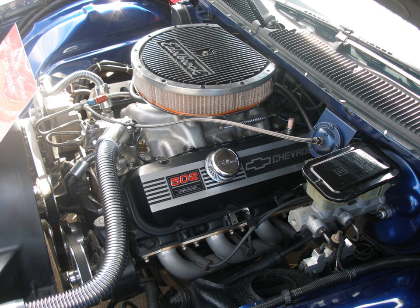L66, produced 1969, rare 2-barrel carburetor, 9:1 compression, nodular iron crankshaft, hydraulic lifters, oval port closed chamber heads, and two bolt main caps — produced 265 hp. L78, produced 1965–9, had a Holley 800 CFM carburetor, compression ratio 11:1, forged pop-top pistons, aluminum high-rise intake manifold, steel crankshaft, solid lifter cam same as the L72, rectangular square port closed chamber heads, and four bolt main caps — produced 375 bhp in midsize cars, 425 bhp in Corvettes.